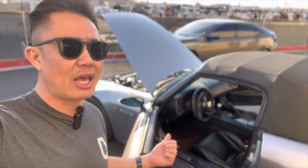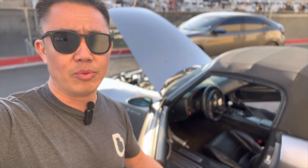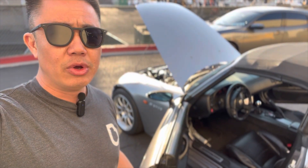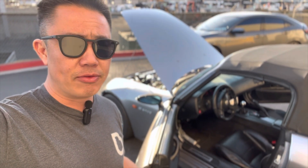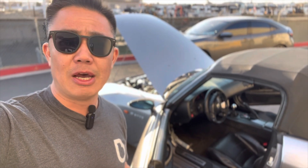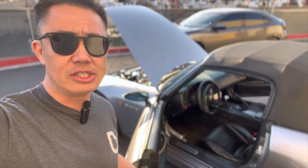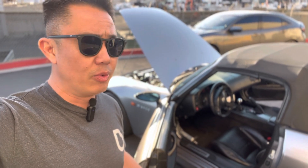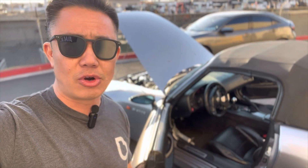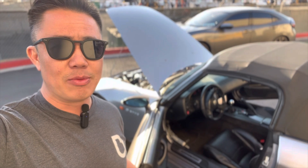We did this a few years back, and then it's gone through some firmware updates. What we ended up finding out was there was an issue with the fact that everybody's engine timing was messing up our software, and it was causing an error for the ECU. The ECU was having a timing sync error with the cam and crank, and what ends up happening is it started hitting rev limit past 8,000 RPMs, which we didn't find out for the longest time.